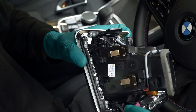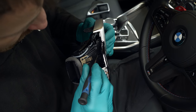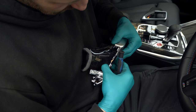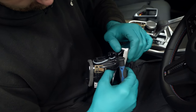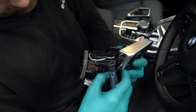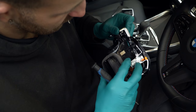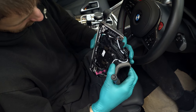Being very careful to peel it away from the vent without damaging it, the next step is to pull these tabs off and then pull the vent out. There are two tabs at the top — be very careful not to damage the tabs as you're bending them. If you put a bit of pressure on the vent as you lift the tabs, it should push the vent in enough to stop the tab from re-clipping. That's the two on the top, and then there are three on the bottom — same process. Once all the tabs are undone, wiggle out the vent.